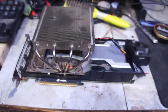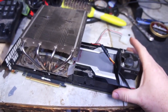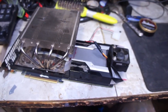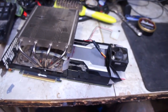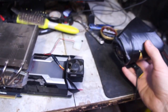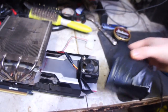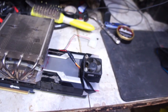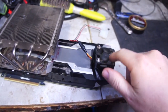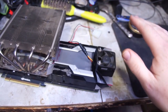Discussing cooling for a Tesla GPU — these don't come with fans. There's quite a monstrosity going on here. Originally, just to make sure the thing would run before committing too much time or effort, I had a 12,000 RPM fan taped on the end, which is very loud and obnoxious. For the VRM, a 40mm fan at full speed is obnoxious, so it's connected to 5 volts through Molex — that's more than enough for the VRM.